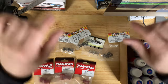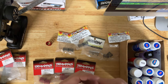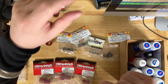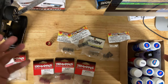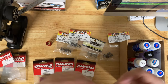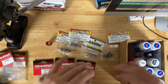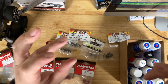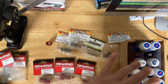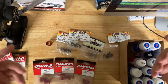If you're bottoming out a lot and your ride height is set properly, you probably want to change your oil — go slightly heavier — and then change the springs to adapt. If the car seems really slow overall but handles well, you may want to step up both front and rear springs. Say you have 2.5 in the front and 2.6 in the rear — try 2.6 in the front and 2.7 in the rear. You'll be surprised how much more traction you get just by stiffening up the springs a little, but don't go too wild or the car will start traction rolling or sliding.